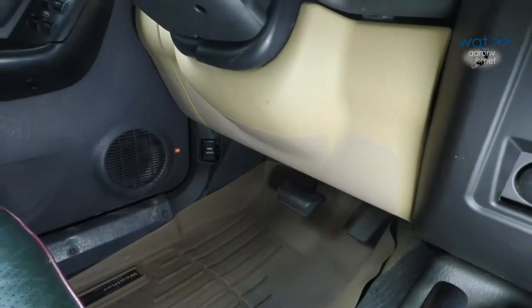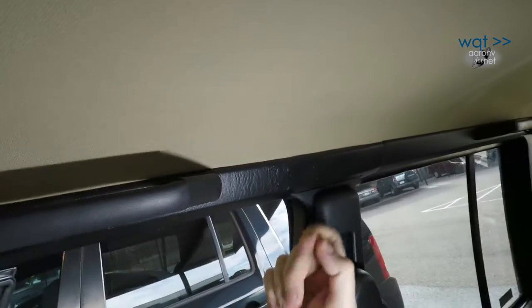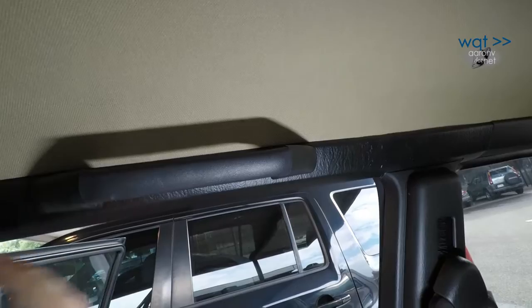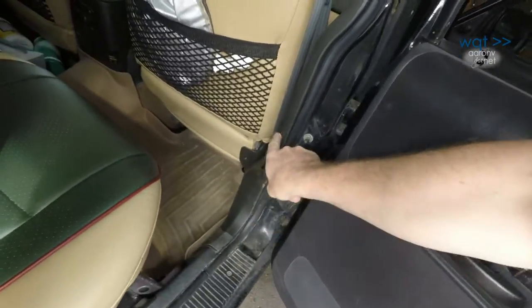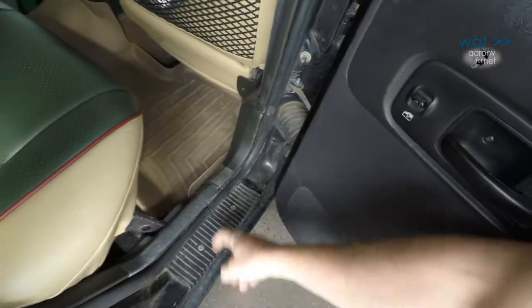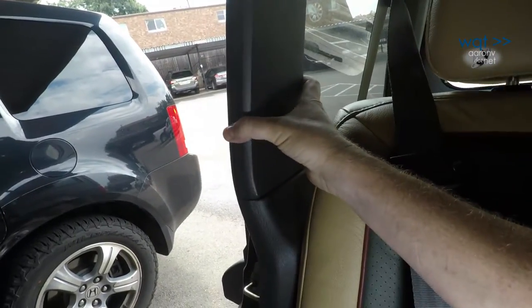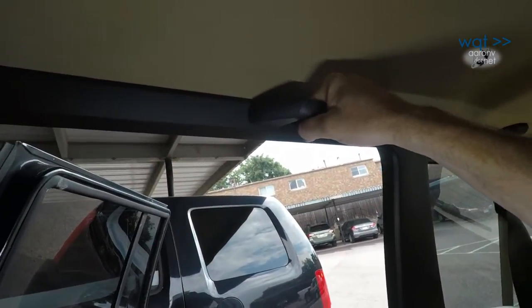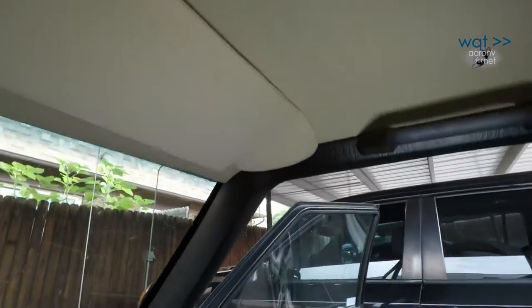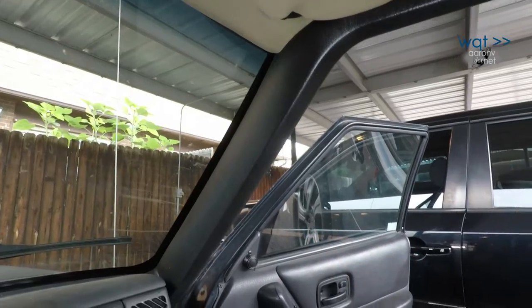The same thing applies on the driver's side, except now it's involved with the hood release. Coming up here is another piece all the way across the top, which also has to come out all the way back along with this handle — remove these two plastic pieces and there are a couple screws back there. Coming in on the rear side, you've already removed two pieces when you got into the front, including that screw. Then this panel has to be popped out. There's another one here that grips around the rear window and around the seal on this side, and one more cross piece up here along with another handle. It's entirely doable but it's a lot of screws. On this front piece there are a couple retainer clips, and if you're not very careful to work those out gently, you'll actually just snap that old plastic in half — so be mindful of that.